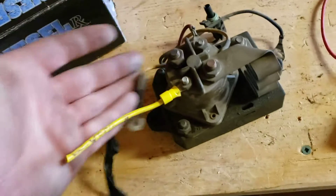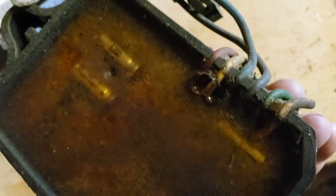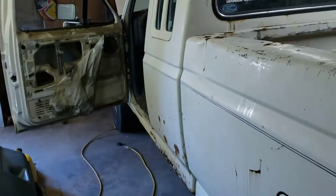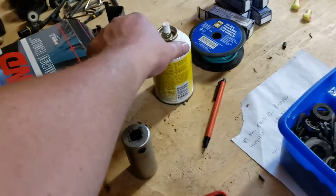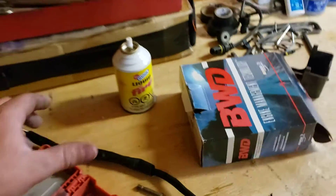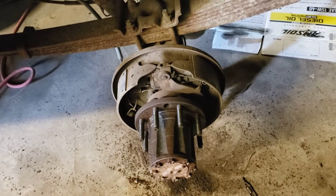The controller was probably still good — this wire was the problem. But it did look a little melty down here, so I think it was wise to just replace it rather than have it work a few times and then burn out and leave me stranded. Without glow plugs, IDIs don't start — by the way, everybody's gonna keep seeing the ether can: I'm not using it in that truck. It was in the truck when I bought it. I took it out to prevent something stupid from happening — I'll use it for small equipment and small gas engines.